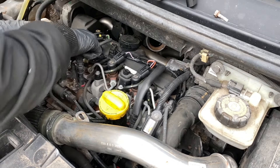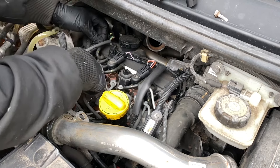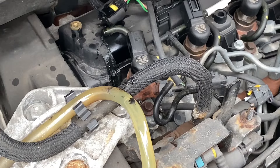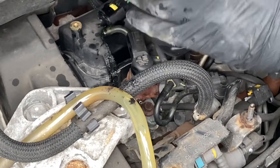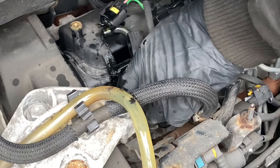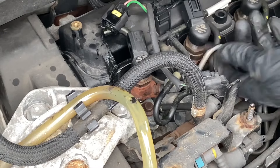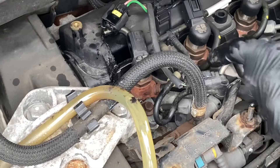Let's get that out of the way. There is a leak-off pipe like so. We've got the actual high pressure fuel pipe connected to it - I think that's probably a 17mm, so let's go and get one of them. Right, I've got that off. I've moved the camera using all the skills I've learnt as a YouTuber over the past couple of years, which as you know is not much. So now I'm undoing this one, and I'll undo it from the other end of the pipe onto the rail in the same manner. And now it is out of the way.